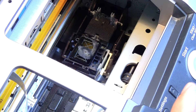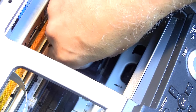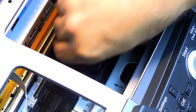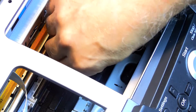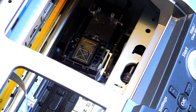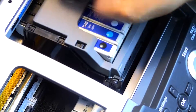This is not something that will remain perfectly clean — you just have to clean it this way every so often. Not every week; every several months you can run this type of procedure, and it will clear up a lot of problems. Now I'm going to take that same paper wipe and clean the wiper blade as well. And that's about it for that area — let's go ahead and move the head back over.